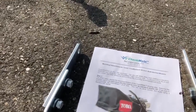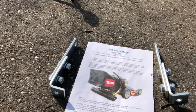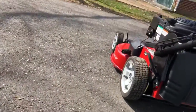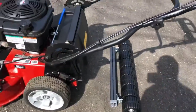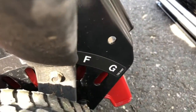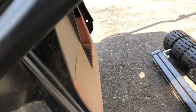Now, the first step, it tells you that we need to drill a 3/8 inch hole into an already existing hole into the frame of the Time Master. It's pretty terrible to have the GoPro set up but not even turned on to do this. So that hole right there, we need to open up to 3/8 of an inch, both sides.